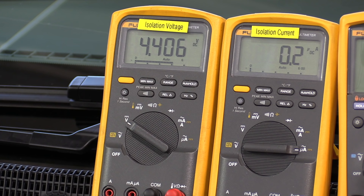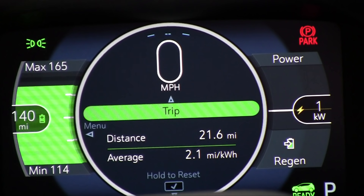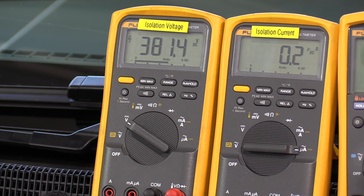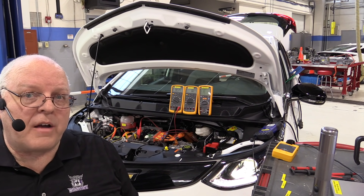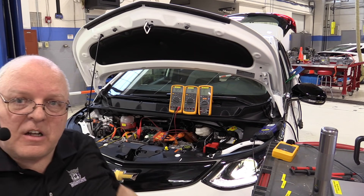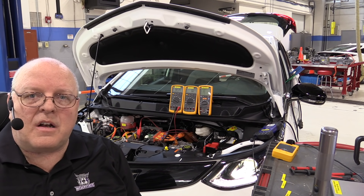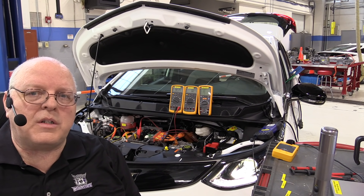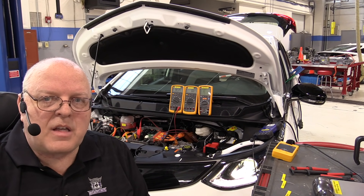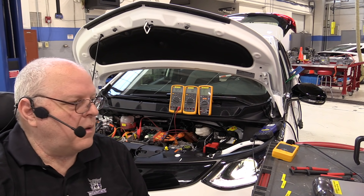Let's power on the Chevrolet Bolt EV and see what happens. I have no warnings, no check engine light. Notice we still have 381.4 volts with that jumper wire connected. With that jumper wire connecting high voltage battery positive to the housing of that distribution module, we have connected the entire vehicle chassis — all the sheet metal on this vehicle is now connected to 381.4 volts. But that doesn't matter; it's not an unsafe thing, because unless you touch both the high voltage positive and the high voltage negative at exactly the same time, there's no risk of shock.